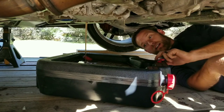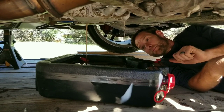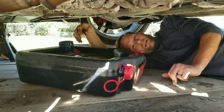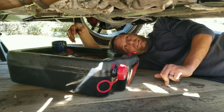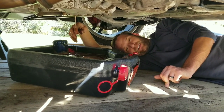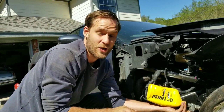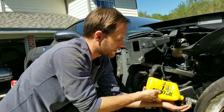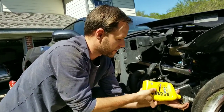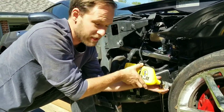I feel pretty guilty that I ran it already for a minute. Hopefully it'll be okay — I can always rebuild it, just like the pyramids. My neck is a little hurting — I feel like I have taco neck syndrome. But I just got some SAE 30 I had laying around for my lawnmower. We're just trying to purge the lines a little bit, clean it out — figured it's better than nothing, make sure all the water's out of there.